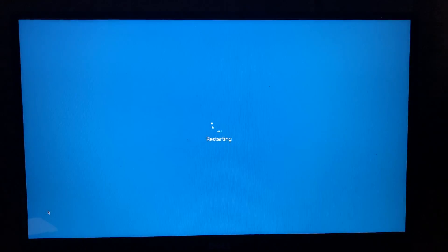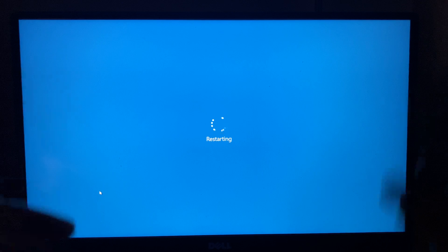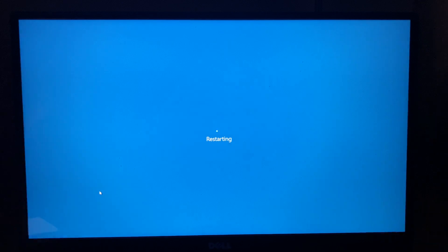Restart your machine and we're going to boot in. Remember, I need to press F2 — you might need to press F12 or Escape. So we're going to boot onto our USB device. Just wait for this to restart, and then when it restarts I'm going to start pressing F2 to go into my boot mode.